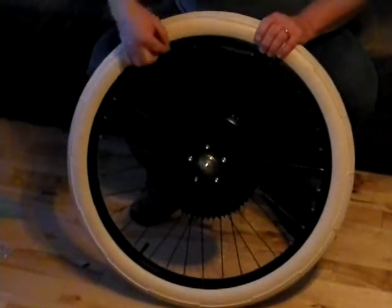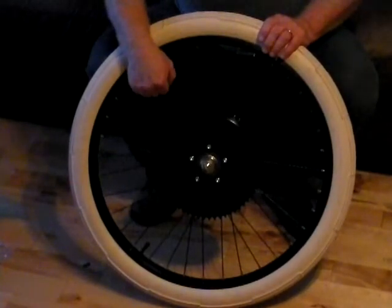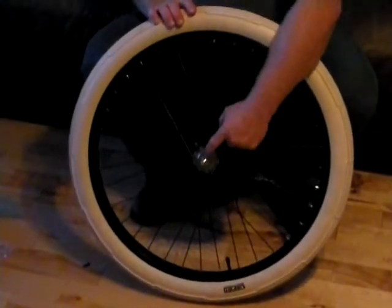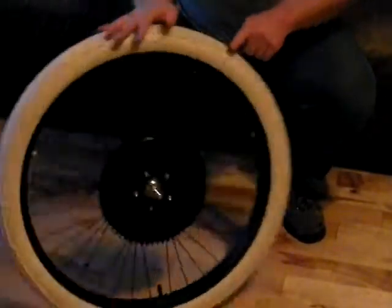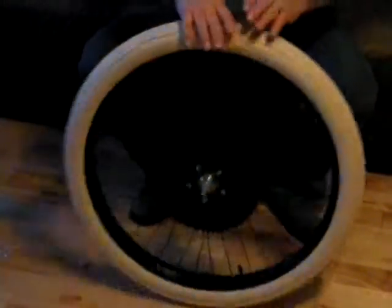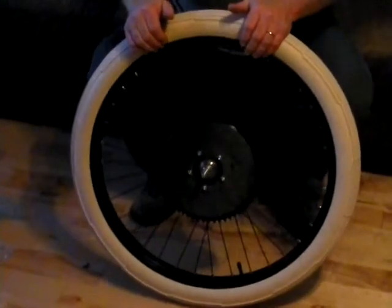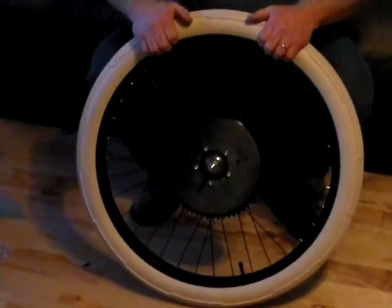The HD wheel has double-walled aluminum rims and 12-gauge spokes. It has the HD Axle Kit incorporated in it with the sealed bearings, and the sprocket is attached to the hub the same way you see here. They are a little bit expensive, but they are very, very worth it for the safety aspect, because when you are doubling the speed of a bicycle, the safety margin diminishes significantly.